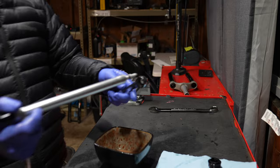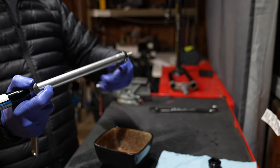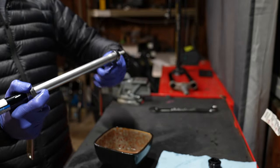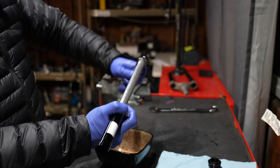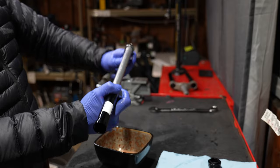The rebound shim stack requires proper shaft clamps — there's no bypassing it. The rebound range on this fork is too slow. There are wrench flats on the cartridge: the bottom one's a 17 millimeter and the upper one's a 23. You can do some hackery to put this back together without the proper shaft clamps, and now it's time to bleed this.